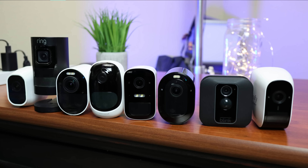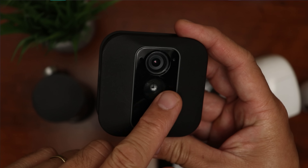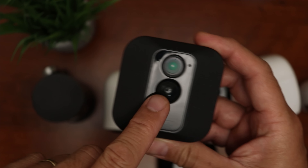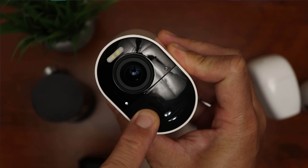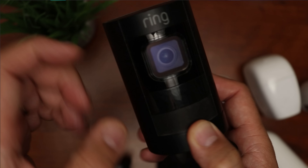If you are new to security cameras, especially Wi-Fi cameras, this is the simplest setup you can do and you don't even have to drill holes or climb up ladders. Most indoor Wi-Fi cameras can detect motion through glass, except for all battery-powered ones and any camera that uses a PIR sensor, because heat sensing — how passive infrared detection works — doesn't work behind glass. All battery-powered Wi-Fi cameras use this sensor, and you can identify them by the half-dome Fresnel lens on the front, or a soft dark plastic area on cameras like the Arlo and Ring battery-powered ones.